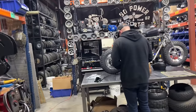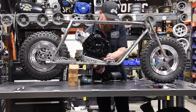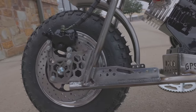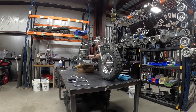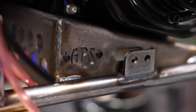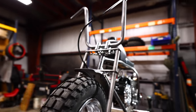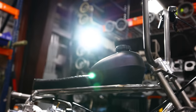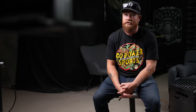Explain the Rascal GT minibike frame. It's super lightweight, there are hexagon cutouts all over the frame, it's super modular, there are tons of different tabs for different peg placements, you can put your chain roller wherever you want, there are slots for a jackshaft if you want to run one, the slanted motor mount can accept a TAV without having to use risers, and it has an interchangeable rear axle — you can run a live axle or a straight axle. The newly designed unit tank fits it perfectly, front suspension can be easily added, and it's just a beautiful frame.